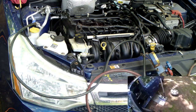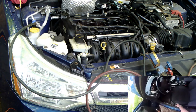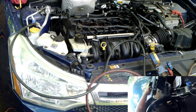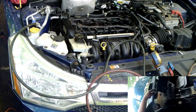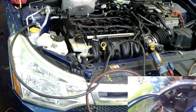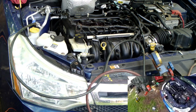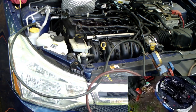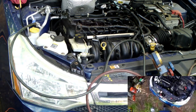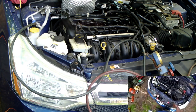It's got a thermostatic expansion valve in this vehicle, so pressures are set by that. We're down to about 40 degrees, which isn't bad, obviously. It's probably about 60 degrees out here, so a 20 degree drop is not bad. And basically how you have to gauge it is by ambient temperature versus AC's temperature.